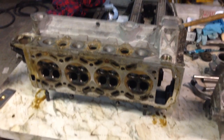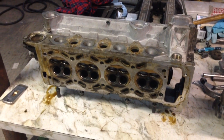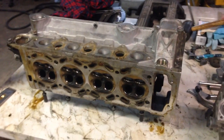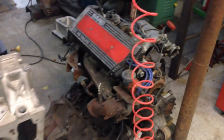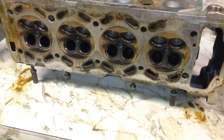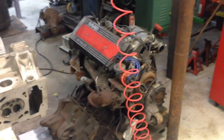So I'm going to explain a couple of the differences and do a little bit of math to show people some of the stuff that I figured out, so anybody can reference this video for information that took me a while to figure out. If you have a 1985 stock motor, you have this cylinder head, which has part number 935824. It has a 42 CC combustion chamber and really, really small, horrible little ports — it flows in the 150 CFM range, which is actually really terrible. Because the quench pads in this head make the combustion chamber 42 CCs, the dishes in the pistons on the 85 are much bigger than the 86 and later engines.